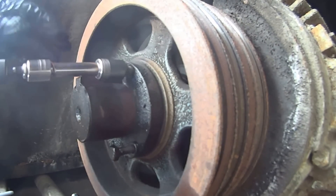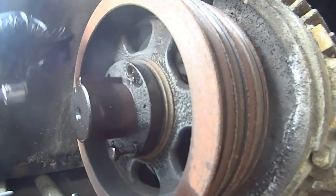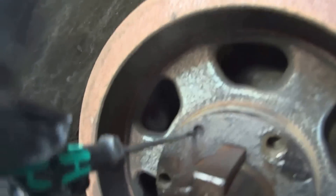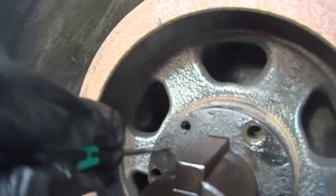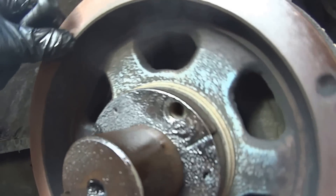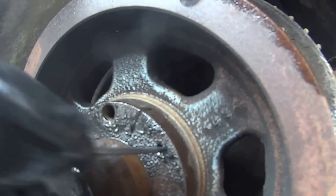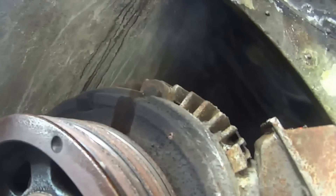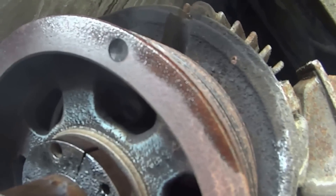So I'm going to take this off using the drill, but I'm not going to put it back using an impact. What I'm going to do is clean this little hole here so I can put those bolts in there to push the wheel off the hub.